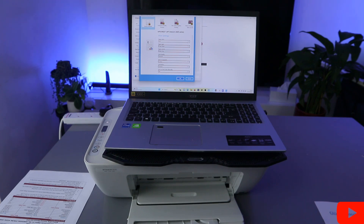Under More Settings you can change: paper size A4, plain paper, main source, print quality normal, and print in color. You can also select portrait orientation. This is where you set it to print on both sides — select Print on Both Sides Manually, select Flip Over, then select Yes to print on both sides.